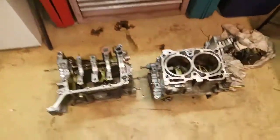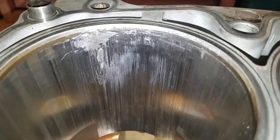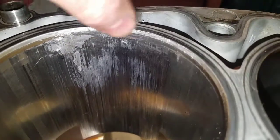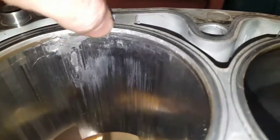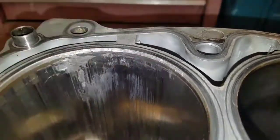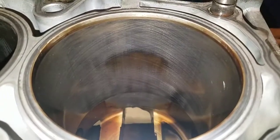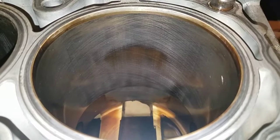The other problem was it scored the cylinder pretty good. The top part right here, I did have to scrape with a pocket knife to get the excess aluminum that was melted on there out so I could get the piston out. But it should look something like that - this is the other cylinder next to it for comparison.